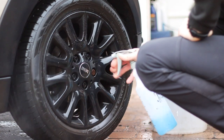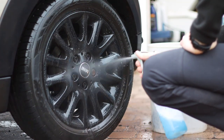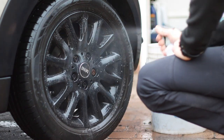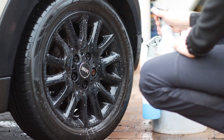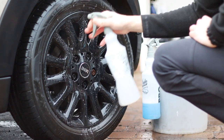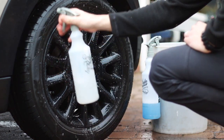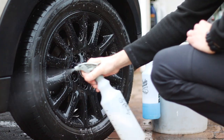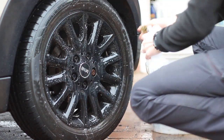First up, wheel cleaning. Get your dirty areas done first, we know that. Of course, the alloy, the tyre and the carpeted wheel well were given a thorough rinse down with a Kranzel K10 pressure washer. Then, once the loose dirt had been removed, I used Ultimate Finish wheel cleaner, diluted down at 10 to 1. It's a bit of a mad dilution ratio for a wheel cleaner.